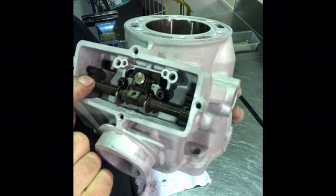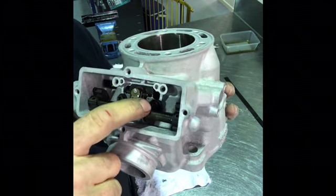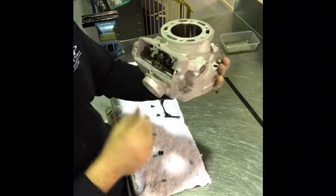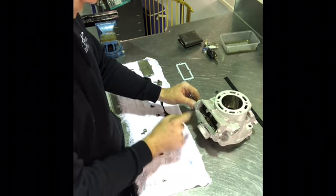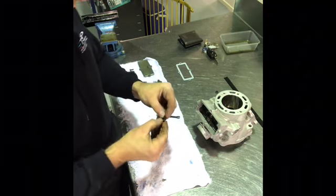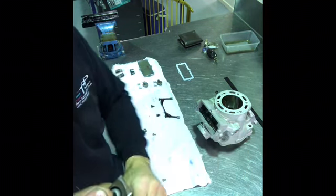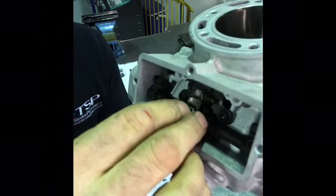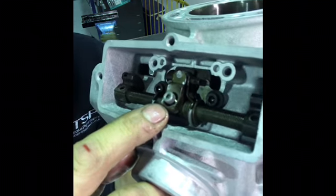So we've got ramp, spring, washer, then the retaining plate that we put in first of all, another washer, another spring, and another ramp there. Next thing to do is to take our 3mm Allen head bolts and put them in, 1, 2, 3. I always start with the centre one. Now the centre bolt goes through this piece here, like that, and then that goes in place. It's only in half a turn, then that goes in place on top of the main flap like that.